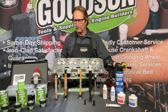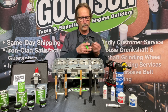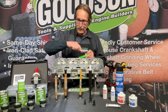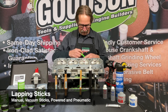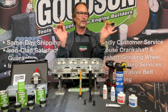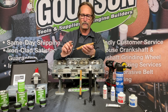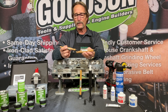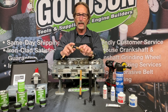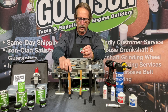Lapping compound by itself doesn't work, because to get these valves to move and oscillate left to right we need things called lapping sticks. Lapping sticks come in a variety of different sizes and configurations. Probably the most popular ones are these double-ended vacuum sticks. They have a small and a large suction cup on each end. The cups are replaceable — over time they'll get hardened and brittle and need to be replaced.